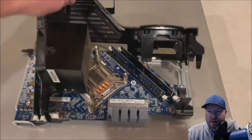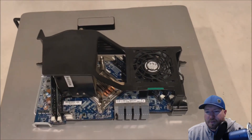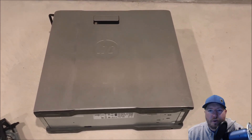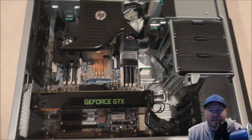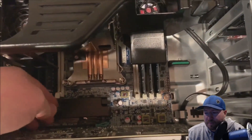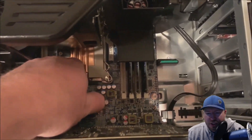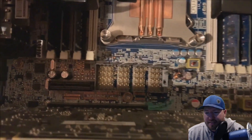Okay so we've got our processor and our memory installed. Let's put the black shroud back on. Now we've got to open up our side panel again, and at this point we just need to remove that black plastic cover that's protecting the pins for the secondary CPU riser board. Right in the middle there you can just pull up and kind of shimmy it right off, and now we have access to those pins.